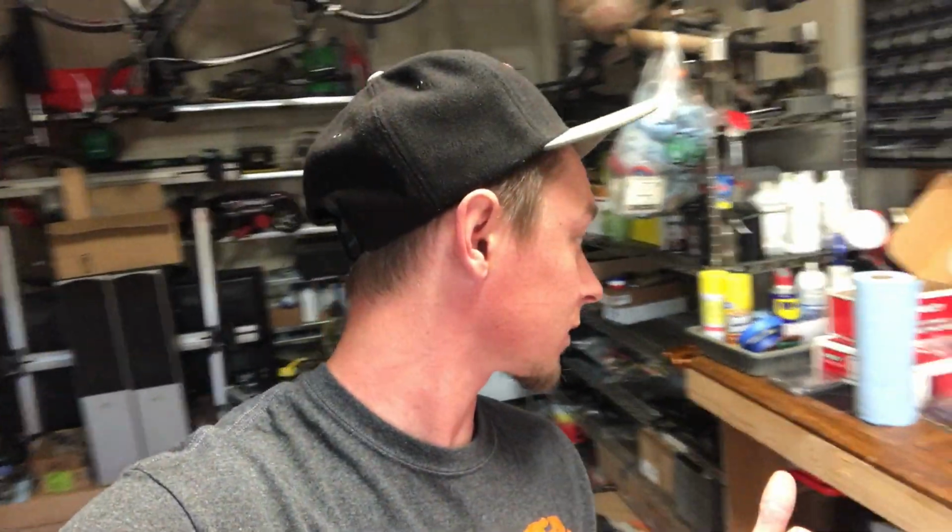Rally Sport Direct, super helpful with all of this stuff. Called them up. They had no problem. They said, yeah, this usually takes a while to do, just to give you a heads up. So as long as it's coming, that's totally fine. I thought I was going to have to try to make do with what I had, maybe gap everything else up to 30 thousandths, but that'll be sweet. It's on the way. Yeah, so we'll get to working on this crank and putting these Manly I-beams onto the stock crank with some new King bearings. Yeah, King bearings. So let's get to it.